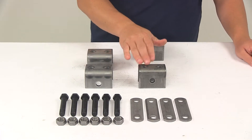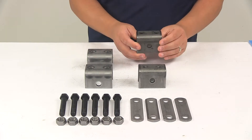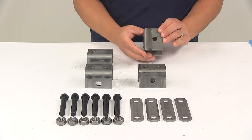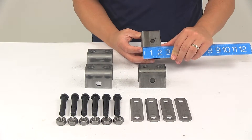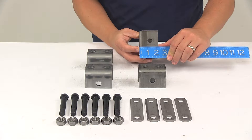It's going to come with two rear hangers. These are going to measure an inch and a quarter tall. This would get welded to the trailer frame, measuring from the top to the center of this hole — that's going to measure an inch and a quarter. That's how we get that height measurement on this hanger.